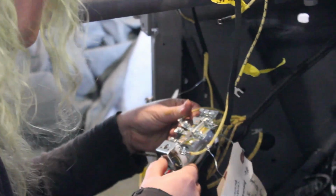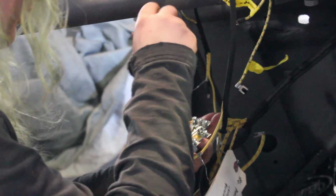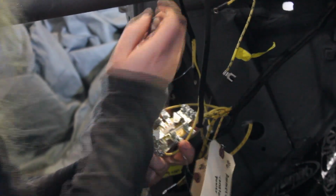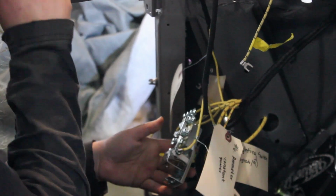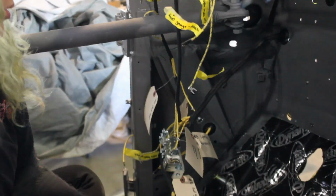I am currently starting our 12 volt conversion on this car. It was originally 6 volts. And so what that means is that I've gotten a 12 volt battery, gotten a 12 volt coil. I have replaced the original generator with a 12 volt alternator that looks like the generator. I've taken the voltage regulator and I've created a jumper wire so that it is basically obsolete, but it looks original. Got new horns, new horn relay.